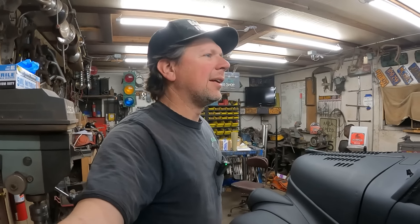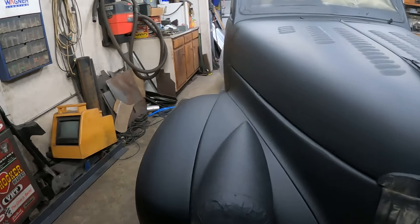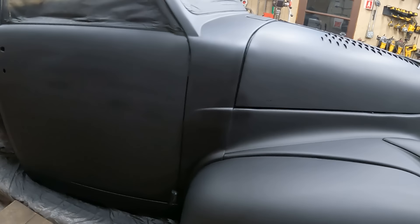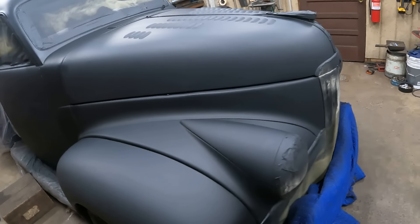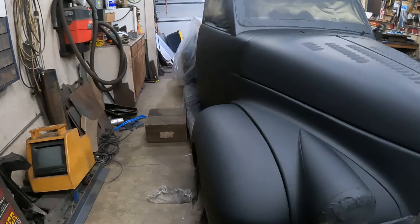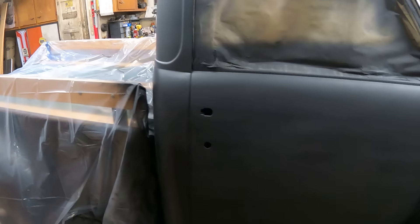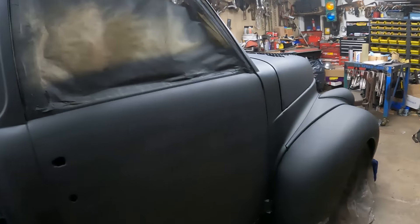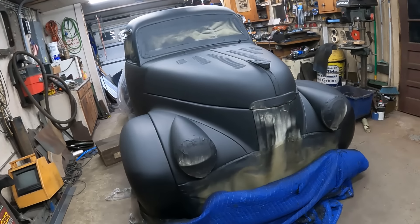I know Dylan McCool did a cop car with one, and I guess this is flat — it's good enough for here. At least it made the truck all one color. Even though the doors are a little streaky, they'll probably dry — this is less than an hour away. You can see some streakiness in the doors there; hoping it'll dry up and look a little better. I was going to blow some more on the doors, but I don't like how that's a different color there. I had to take my coverall pants off because they were super greasy and every time I touched the fender it left a grease mark on the flat paint. I wish I had one more turbo can — if I had one more I would have hit the doors again with a second heavy coat and done a little bit more on the roof. But it is what it is — it's a rattle can paint job.